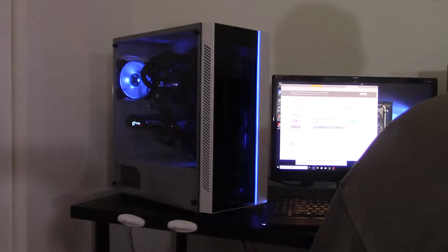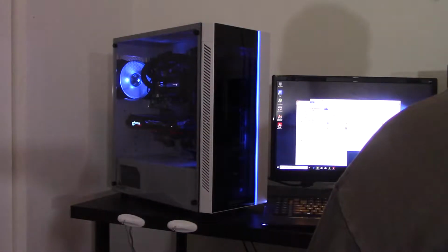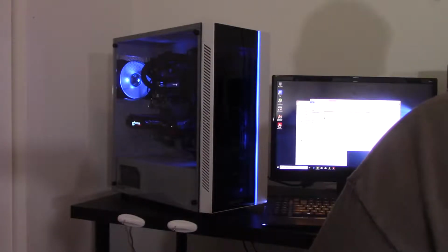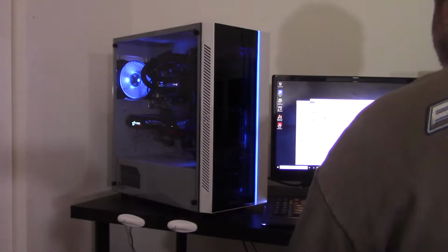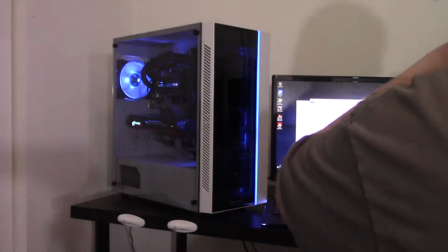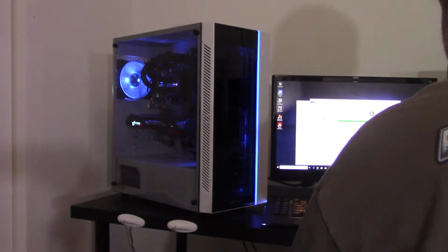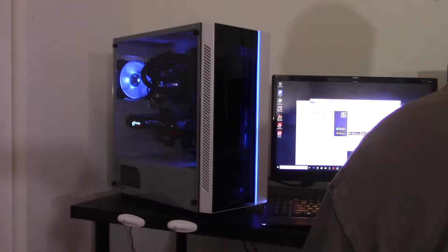So, okay, the CPU is fine. It's working perfect, actually. I actually forgot to plug in my wife's pump, and if you don't plug in the pump, it will overheat. Lesson learned. It wasn't intentional by any means, but she wasn't particularly happy. That was on the 2600X. It's in her system. We swapped it in because she games. She doesn't do any kind of heavy workload, so this little bit of speed advantage made sense for her.